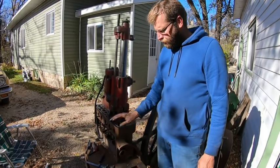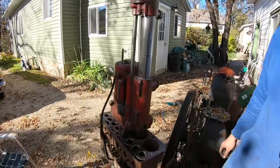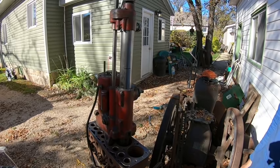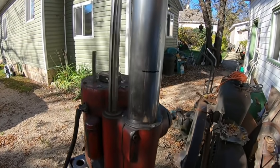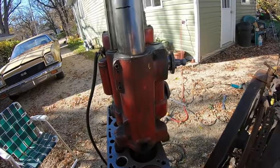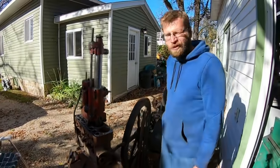I don't know what you can hear — it sounds okay, seems like it's cutting okay. We're almost half done now. Here's your feed here — and this one's a two-speed boring bar but only single feed. You can get these guys in a four-feed — that'd be nice, like an S4.